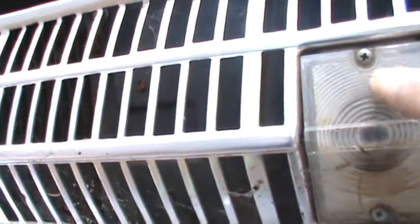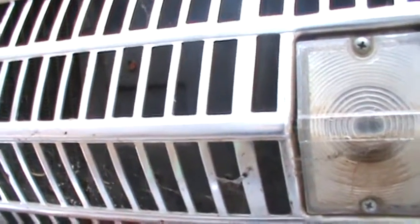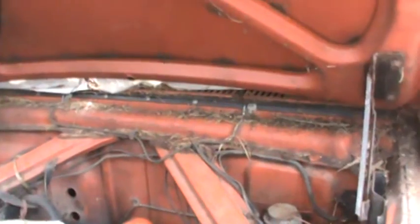For some reason the tail lights work fine, but the parking lights up front didn't work. I got them to work somehow — I tightened the wire, tightened the positive lead from the battery over to the brake light switch. I don't remember exactly why I was doing that, but that's how the parking lights came back to life.